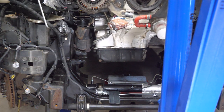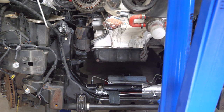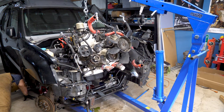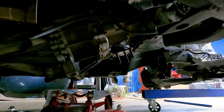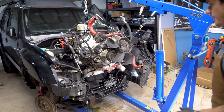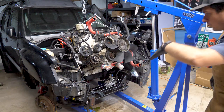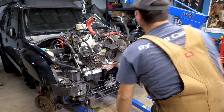Nothing smashing anything else, so I guess go further back. Up top you've got to keep your eyes here because we're getting damn close to that wall. I'm going to check the transmission — I'm very concerned about it. Slide that jack back. Still looking good — it's still completely free-floating. We're nearly clearing the steering rack, which is awesome. Now I think if we go down it's going to start going like this — and now we have a lot of space, so let's do that.